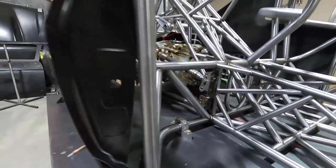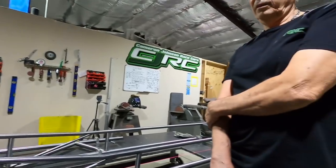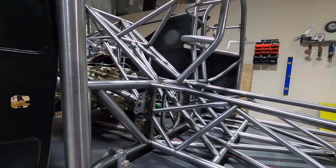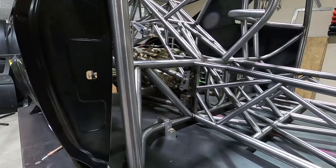The loop notch here — Danny notched it within about 30-thousandths. You notch it all the way down and all the way up so it has a full loop but gives you a lot more drive shaft clearance. If you had the full inch at the bottom and the full inch at the top, that's two inches less drive shaft clearance. It had to be notched to the max because on radial cars the drive shaft separation is so severe — the drive shaft goes down, and you don't want it hitting the chassis. Same story on top — you want all the room you can get.